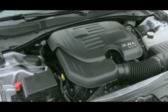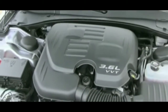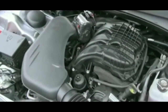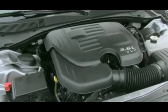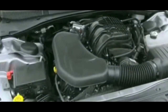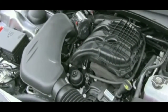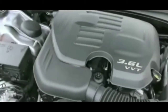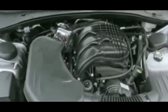Here's another DIY diagnosis troubleshooting fix if you have issues with your Chrysler 200 — a no crank, no start issue. A lot of these cars with push start have brake switches. The brake switch is on the brake pedal, and if that brake switch has issues or is malfunctioning, your car will not start. Everything will turn on but it will not crank because it is not reading that your brake is depressed.